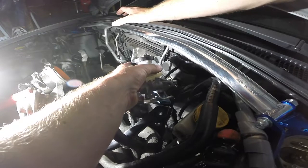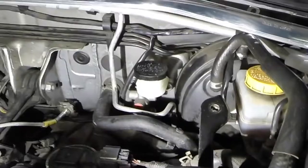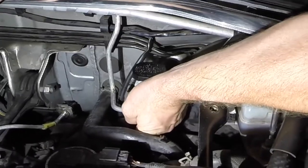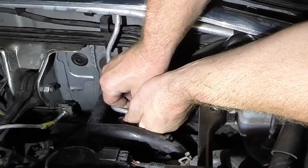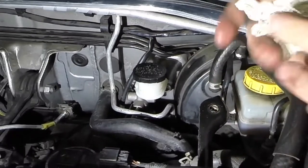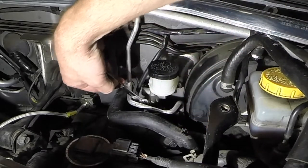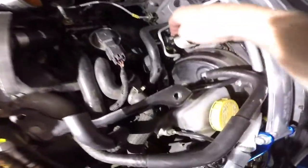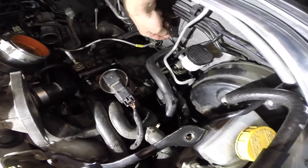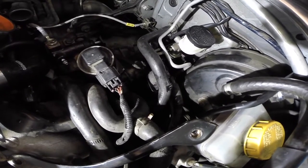I'm gonna feed this right back on. I'll just thread this nut onto the left stud there. Before I start leaking brake fluid all over the garage floor I'm gonna attempt to put this in. Push it in, screw it on — minimal leakage. Always be sure to have a towel because brake fluid is nothing to mess with. We're just gonna tighten up this hard line here — 10 millimeter. Keep tightening it on and move on to the mounting bolts. Everything's mounted up nicely and then we're gonna go into the cab and connect the linkages back up to the actual clutch pedal and then we're gonna bleed the system.